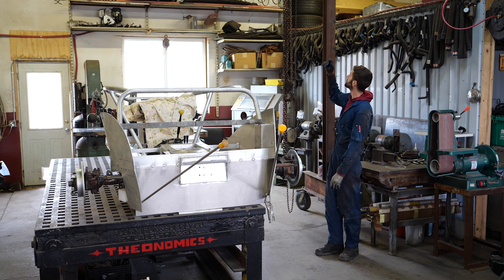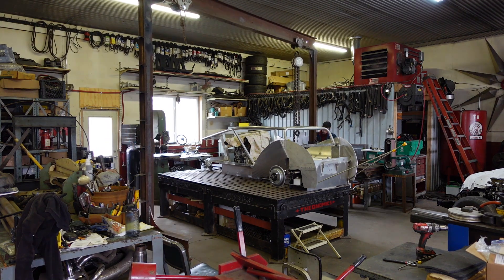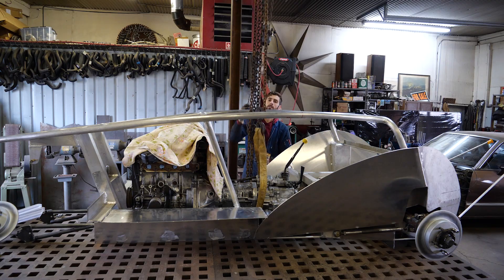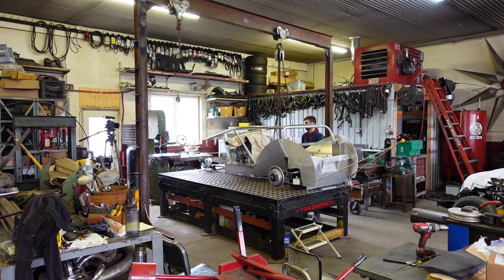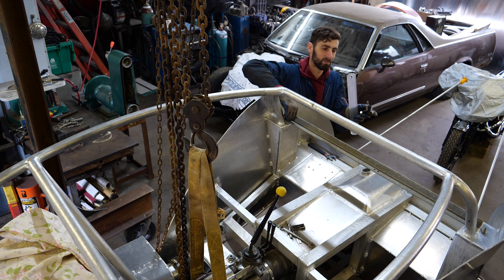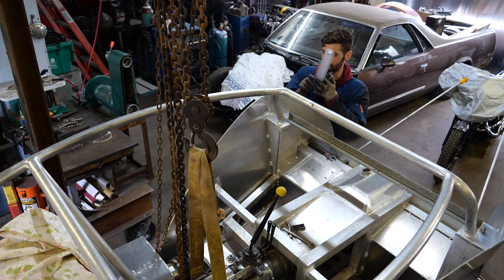I got this hoist. Basically you have to strap it in the center and pick it up. This is just gonna wrap around the transmission. I have to adjust it a little bit to get it balanced. It's going up. These things are just plastic mock-up pieces because the coilovers are springy so they'll never sit at the same place, but these will — all four corners — be at ride height.